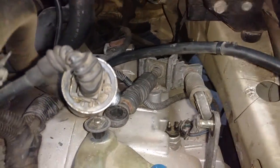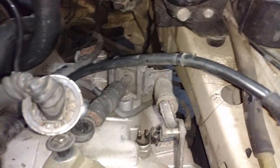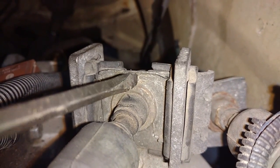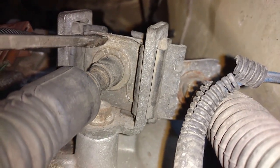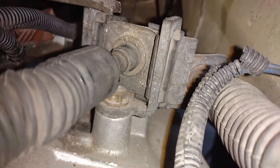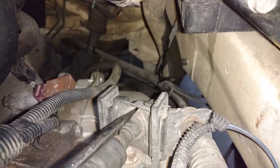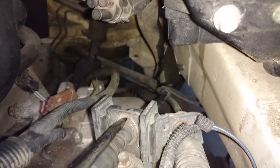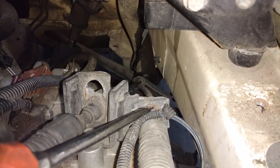and pop these clips out. These clips pull out of here so that the cables are loose. So I'm going to pry those up and out of there. The way to get these clamps loose is get a large screwdriver, put it there and turn it. That'll start them on both sides, and then get a pliers and pull them up out of there, because they're in here pretty good. They're tight. Here you go. Put that there, twist it. See how it's raising that clip up? And there you go. That's how you get those out. Do the other one the same way.